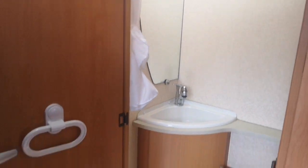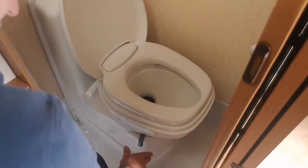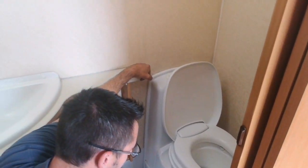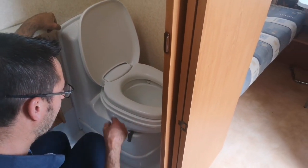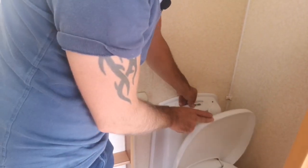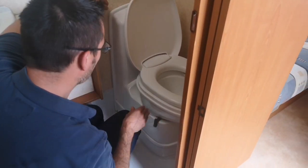While we're in the bathroom - regarding the cassette not coming out and the little trap door not being fully closed - we've got a little grey lever at the side here which opens and closes the little shutter inside the toilet. When you come to remove that cassette, make sure this grey handle is fully back and the little trap hole is fully closed; that will make sure the cassette can come out nice and freely. To flush the toilet, there's a little plunger flush - just push it up and down and that will push your flush water through. Then to let everything through, open the trap up and that will let everything back through into the cassette.